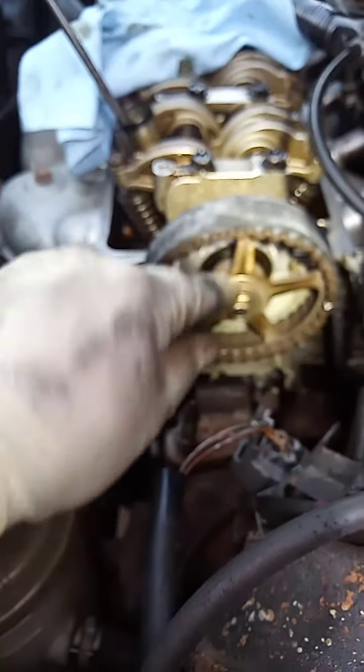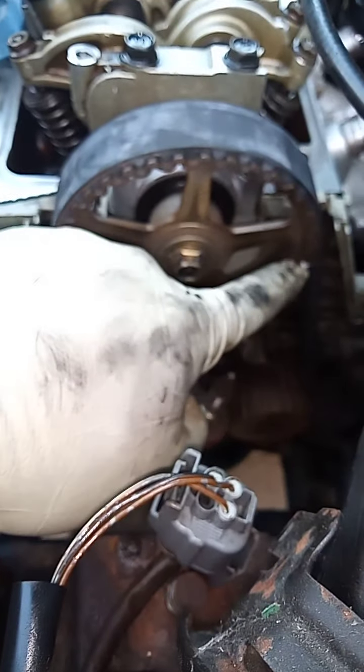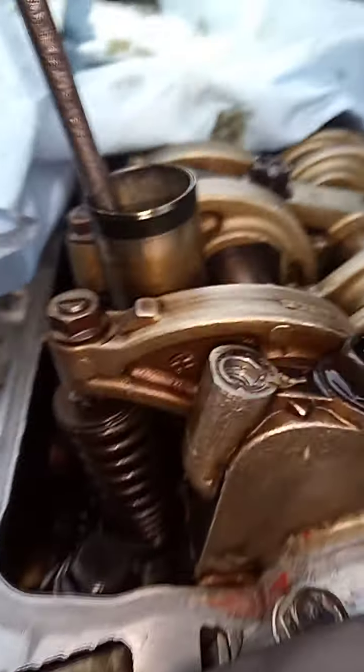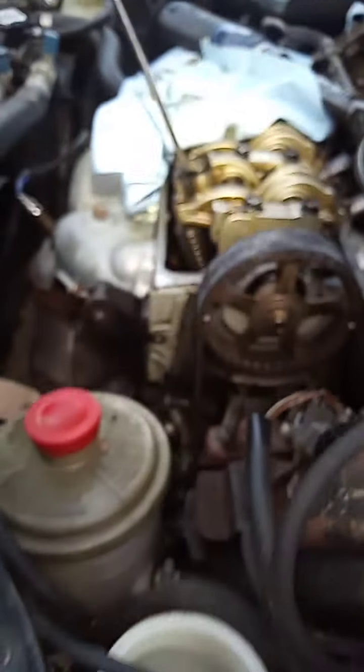That's going to be before taking everything out. When you have that, and the piston is up, and you have this mark that says 'UP' right here — that says up — then you're at TDC. The other thing that's really important to check: the manual shows a mark right here. I have a mark here and a mark right here. This mark is supposed to align to this little mark in here. You see this little mark right here, and there's one on the other side right there. Those are supposed to align, but you're never going to see that they are aligned like that.